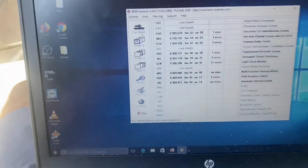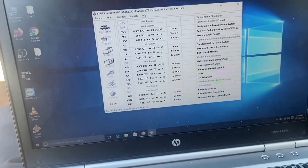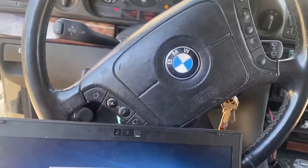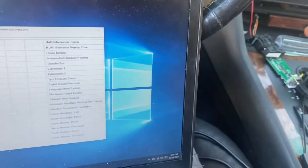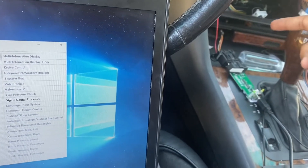It's scanning through a lot of the different modules and pages. EGS, EWS, ABS, AC — whatever is there, it's going to pull up and start showing you errors or whatnot, IKE, LCM, everything. I think in order to scan each and every module you may need the 20-pin connector inside the hood. Since I don't have that anymore, I only needed to access the IKE part of the system, and I was able to do that with this trick.